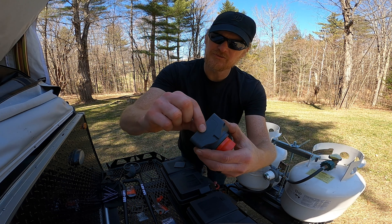I'm going to use the back plate from the switch as my template, mark four holes, drill it, and mount it. Let's see if she mounts up — oh, that's pretty! But the bolts are so long they're going to hit the battery; those need to be shortened. I'm marking where I'm going to cut. The trick to cutting a bolt is you put the nut on first, cut it, then remove the nut and it cleans the threads as it comes off — makes a big difference. Nice and smooth, like factory.